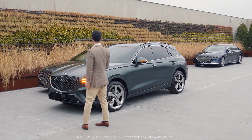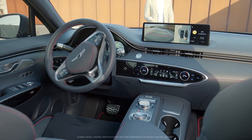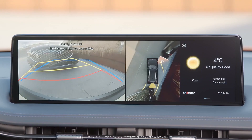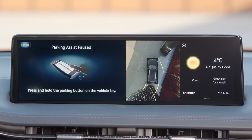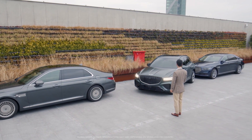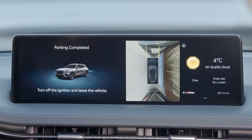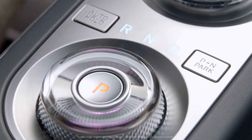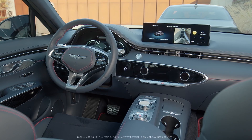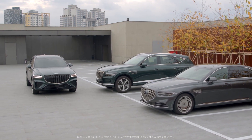Stand in a safe location within 4 meters and press the forward or back button on the smart key to start the parking. Letting go of the forward or back button on the smart key will stop the vehicle and pause the parking. Pressing and holding the forward or back button again will resume the parking. When parking is complete, a message will appear on the infotainment system display and the vehicle will go into park, engage the parking brake, and turn off the engine. You can follow the same procedure for perpendicular reverse parking.